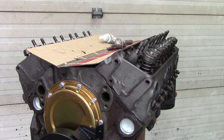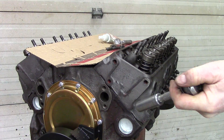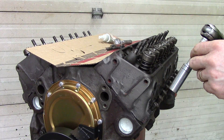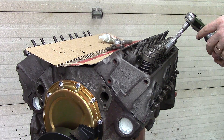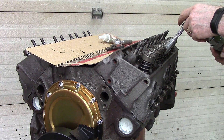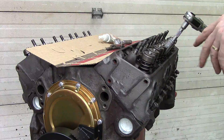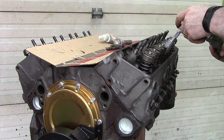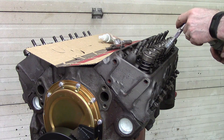Now you've got to watch as you're pulling this down so that everything is going in square and straight, and everything's down on your dowel. It's going to get noisy now because I'm going to use an air ratchet to get my first torque on this. A 3/8 air ratchet normally is about 30 foot-pounds, so I'm going to just bring it down to the point where it is snug, maybe a little over snug, and that's as far as I'm going to go, then I'll go with the torque wrench. I'm going to do it close to being in sequence — torquing basically from the inside to the outside.